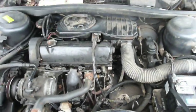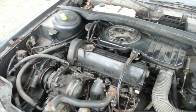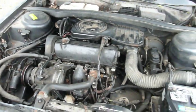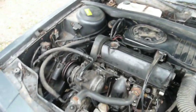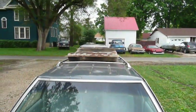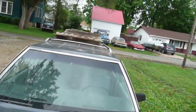Anyway, I took the distributor cap off, and I wish I had it to show you because it truly doesn't go anywhere near explaining just how burnt that thing was. It's really amazing the car ran at all. But it didn't solve the problems, at least not all of them, because the fuel pump on the car is intermittent and has clearly been replaced before.